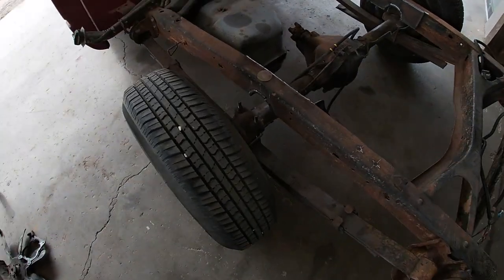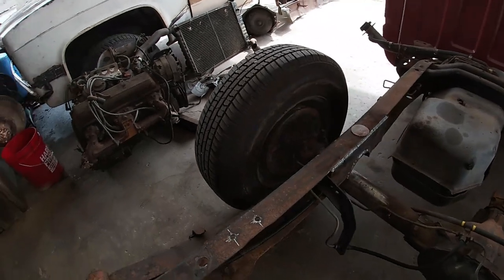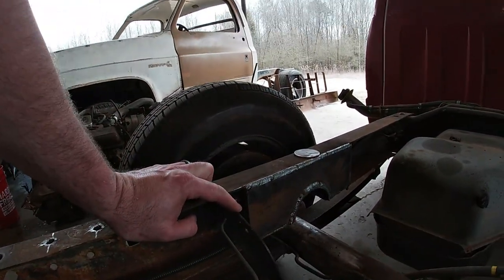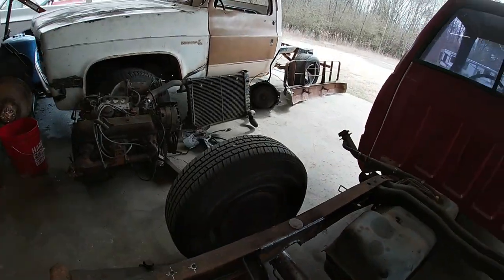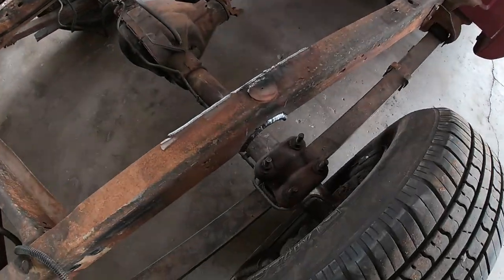All right, well, got my notch all done on both sides, got everything cleaned up, turned out good, it's all back together. Here's the side I didn't do on camera. I still have to remount my rear brake line, but my holes for it are behind there, so I'm thinking about pulling that tab back out, the bracket that holds the brake line on, putting some nutserts in it, and then I can just hold it in place and run the bolts in from outside the frame. But this side's all done. You guys already saw that.